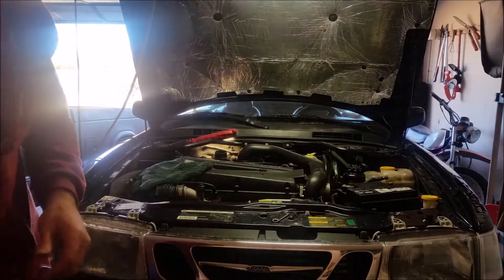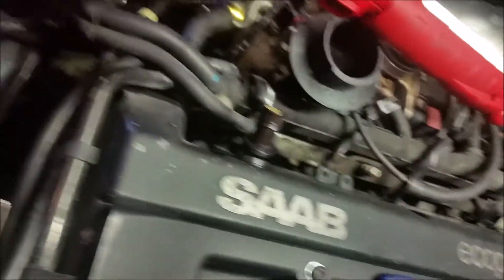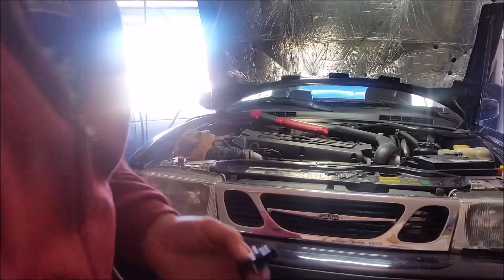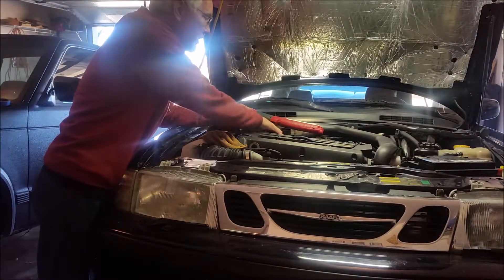Putting a little bit of oil on the rubber ring — Dexos again. That's done. Then it says remove this hose that goes from the camshaft cover down to the vapor recovery box. The hose is in good shape, but I'm still going to replace it because it's part of the kit. Next, it says remove the nipple that comes out. The nipple's got a tab on the top side that just slips right in here. We've got a new one here with a new gasket, so I'm going to do that as well. This nipple is also connected to a check valve which we're going to replace.